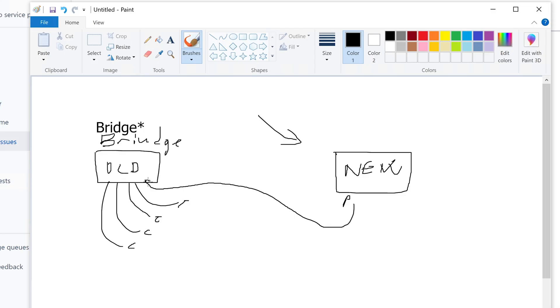What that does is just extend the network, so I can keep using the old cables. I ran one cable to the other floor and set the old router as a repeater, located where most of my computers are. You can set up routers to be a bridge or a repeater even from a wireless network — not all routers support this, but you can log into your old router to do it.